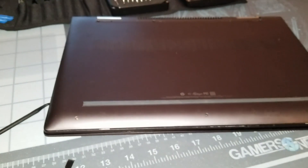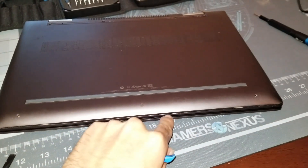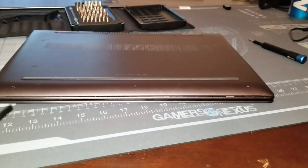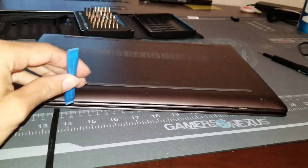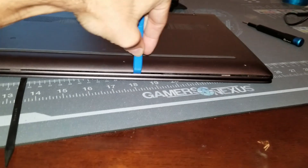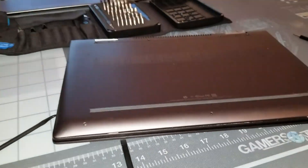Just to give you an example of what I mean by using metal to try to pry up on the laptop — little chips right there, or just scraping the paint off. A little bit of silver right there just pulls the paint off. You can see how it's kind of starting to lift up. You've got to use a flat piece of plastic to kind of pry up. If you have the iFixit kit you can use those tools, but if not, you just need a small piece of plastic. You kind of work this end in there and pop up, and you'll hear clips pop. Go all the way down the sides, all the way back, same thing on the left, and then this should lift up.